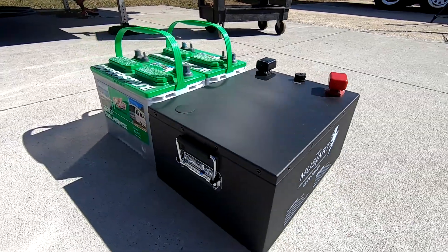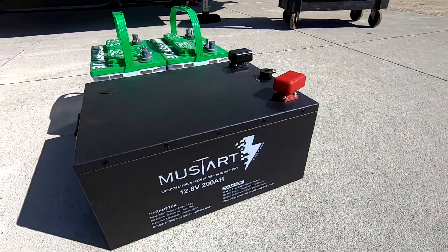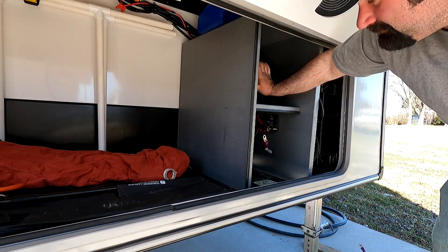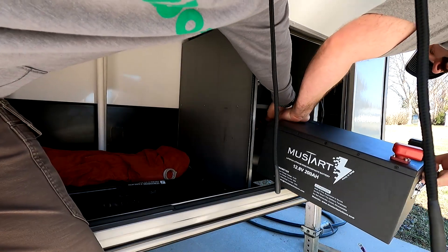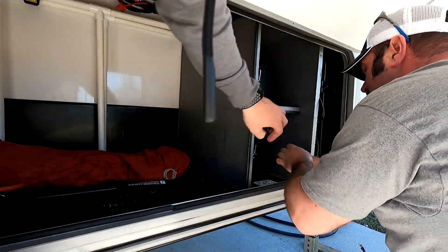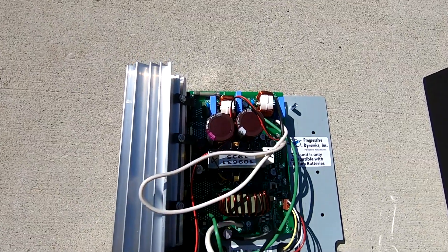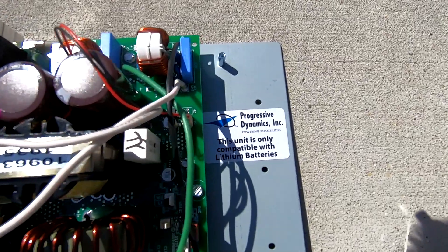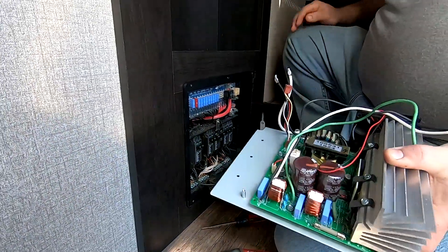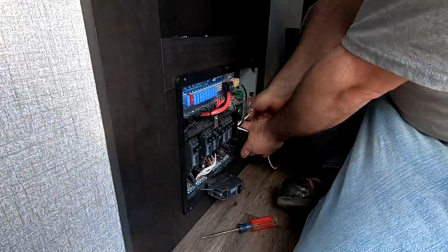First thing you want to check is will this battery physically fit inside your RV. This is a large battery — it is 200 amp hour — so it's a little bigger than even two lead acid batteries you might have in there currently, but this battery is probably going to be more amp hours than those two. It's labeled on the outside as 200 amp hour, but the reality is there is a BMS, or battery management system, that regulates how this battery works. There is a 10 percent reserve in this battery to save it from overcharging and undercharging, which actually leaves you with a 180 amp hour battery. Make sure you really understand how many amp hours you're getting based on the internal controls.